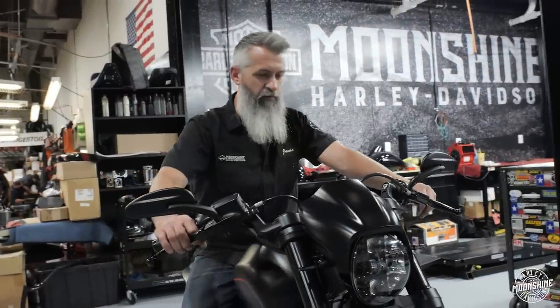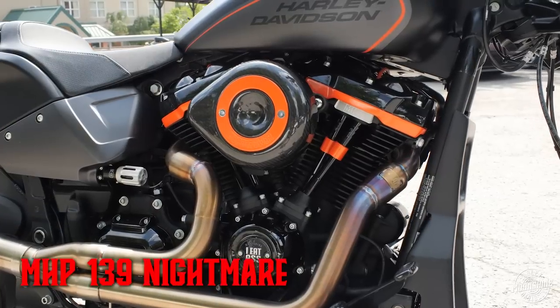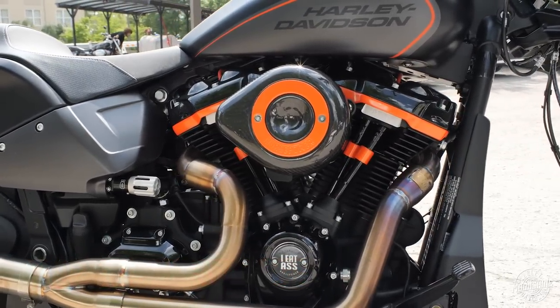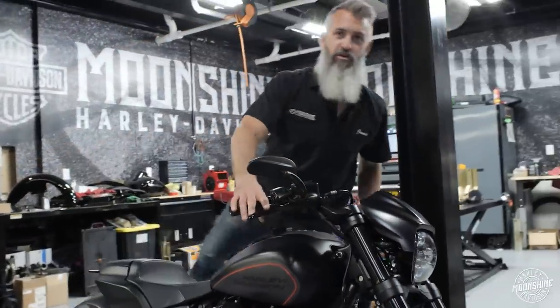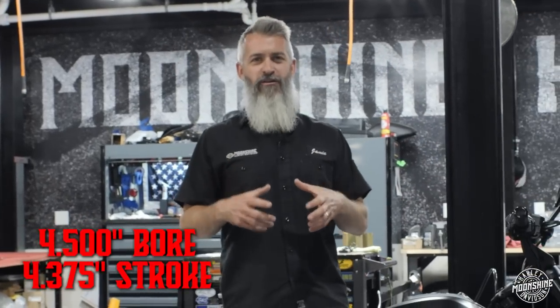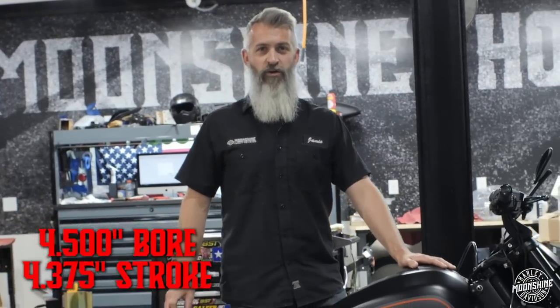This is one a customer sent to us with his son's bike. We're doing two big builds for them. This got our Moonshine horsepower 139 cubic inch nightmare setup. It is an over-square motor — big piston, short stroke. For our 139, because there's all kinds of different ways to get there, we do a four-and-a-half inch big boy piston and we use the 107 stroke flywheels.